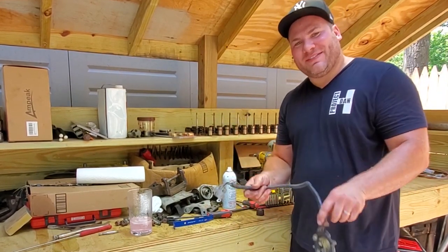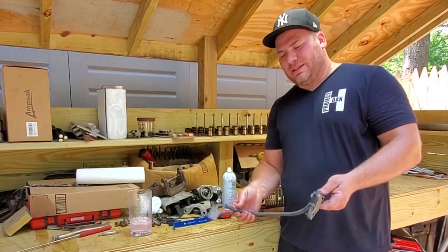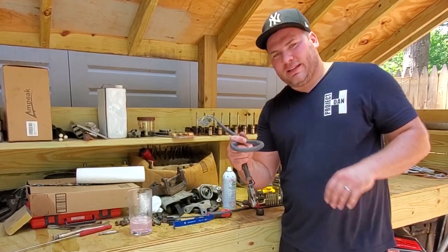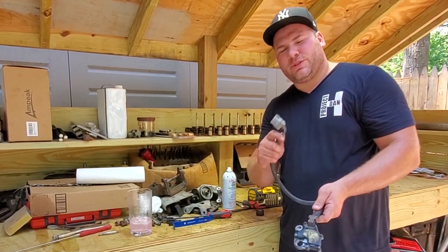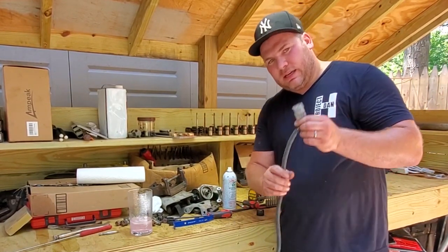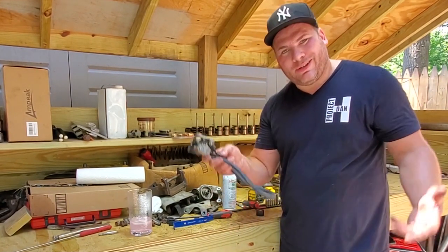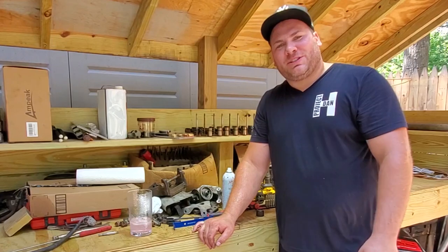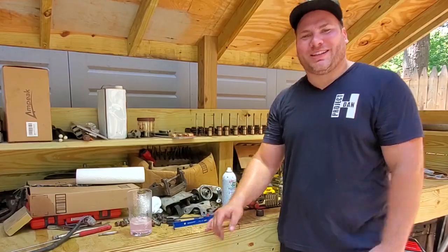Now I know why I save everything — I didn't know when I broke this a couple years ago that I'd be using it for the neutral safety switch bypass to satisfy the park/neutral computer issue when you switch to an AX15 manual transmission. So this pigtail is going to get clipped and I'll keep it around. That's it guys — hope you enjoyed the neutral safety switch swap video. Remember to like and subscribe and I'll catch you on the next project — peace!